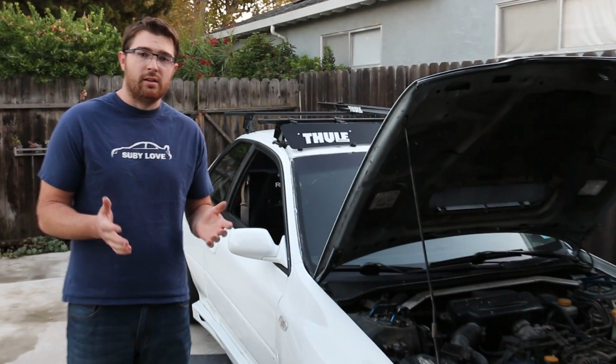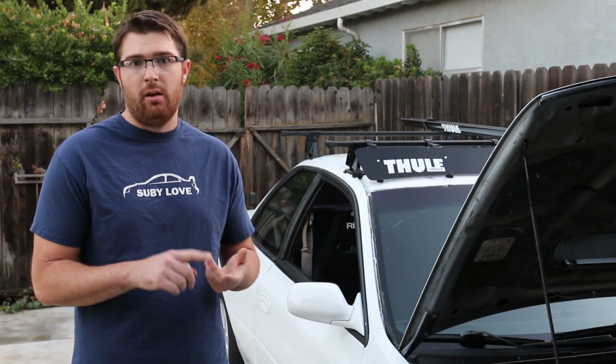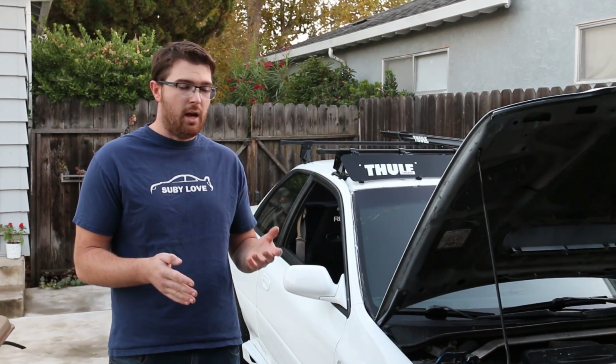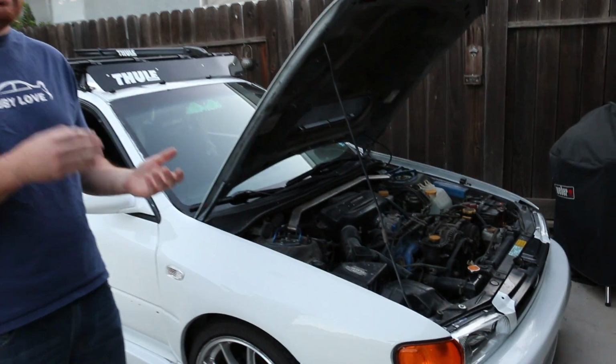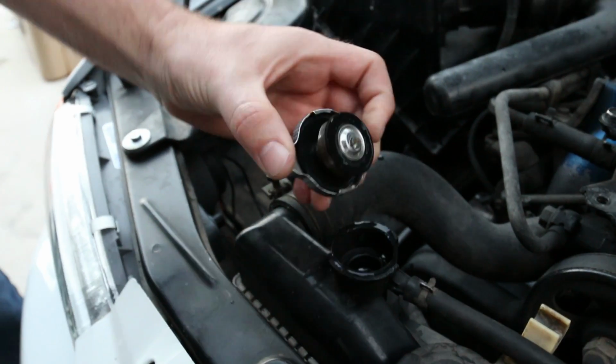So just to give you guys a little bit of history about what I've done already. When I got the car back, just within the last couple of months, I also did the timing belt, water pump, and thermostat, all OE stuff, so we know it's going to be the good stuff. The reason why I'm not convinced is that the very beginning stages of head gasket failure also mimic an air pocket, very similar. So that's another reason why I want to test for that. When you do head gaskets, especially on Subarus, you need to burp them the proper way. I did not do that the first time, and that's the reason why I am where I am today, because I want to confirm if that's what it is. Oh dang! Pop the top.